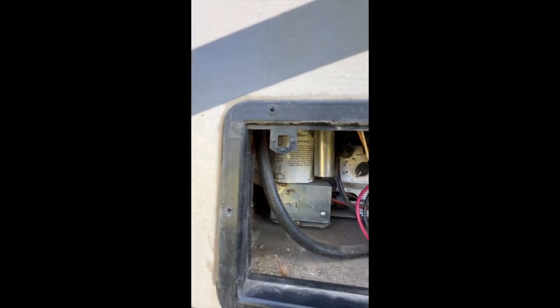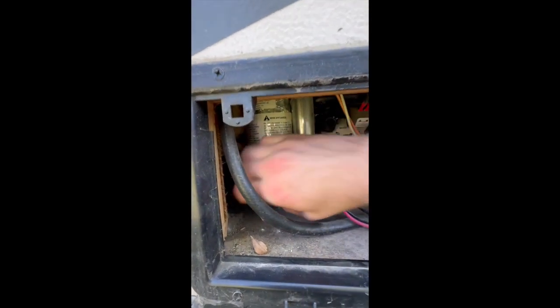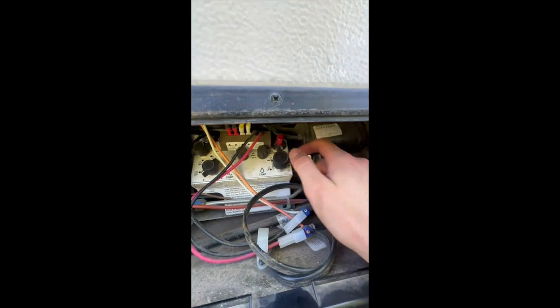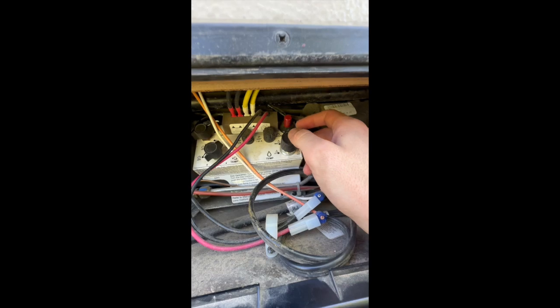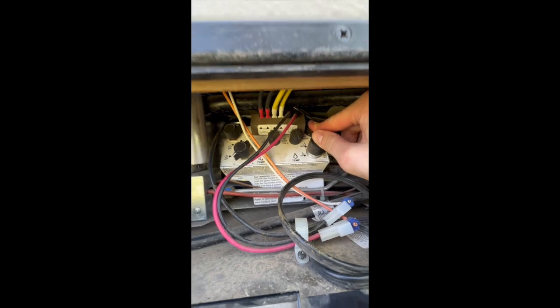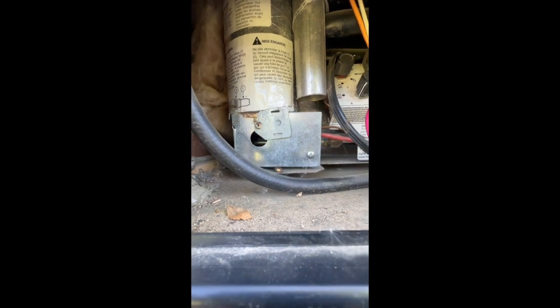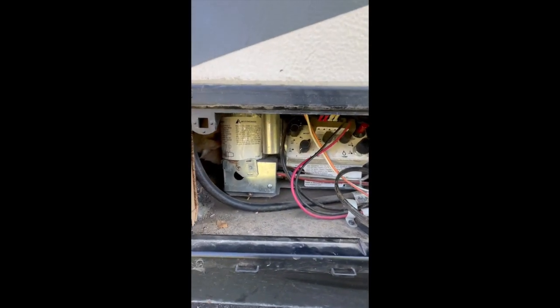And then if you want to use gas, you can slide open this little door so you can see in that hole where the pilot light will light, and then you select from off to high, hold this button down, and then spark your pilot light. Okay, and then after a few tries, you should see a little light come on there. It's very small, and that'll get you going. So I'll leave that on electric. That'll be the default. If you just want to not worry about it and have it on electric, that's what it will be set at.